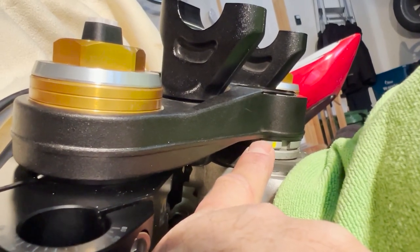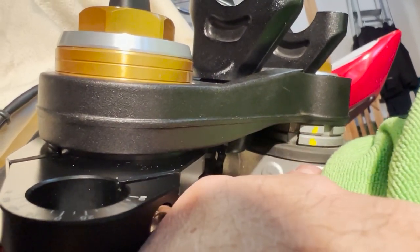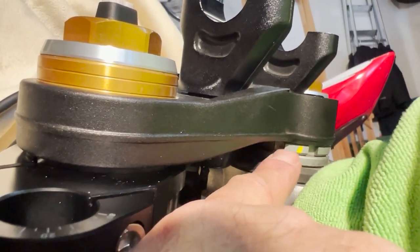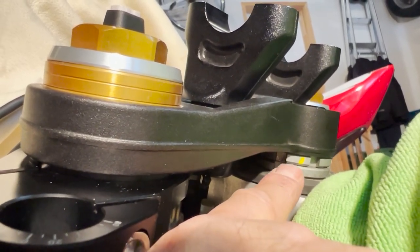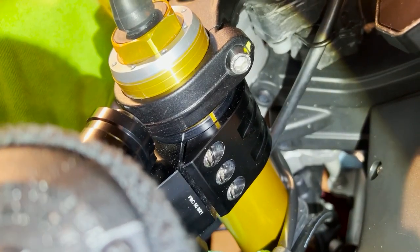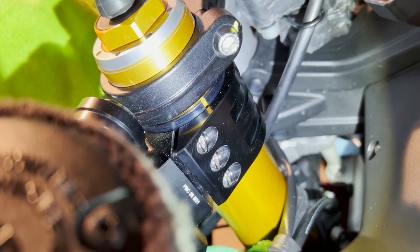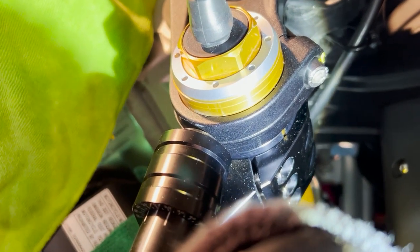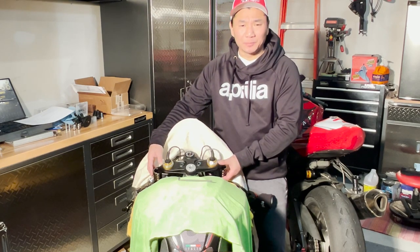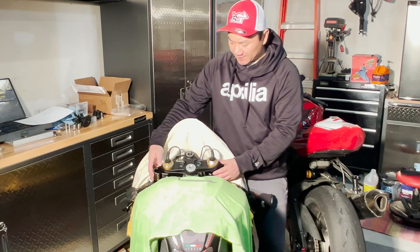Add the bushing screw on top so you don't have a gap when you raise up the triple plate clamp — otherwise it's going to be an eyesore when riding or washing the bike, and it also allows water to get in, so that's no good. Be very careful: you want to align the opening of the bushing on the stanchion with the opening of the clamp.